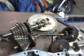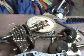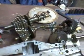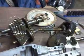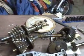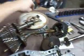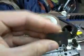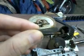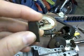also, if your brakes are pathetic and you've adjusted it as far as you possibly could on the caliper, well, the actuating arm on the brake rod, if you've adjusted that nut as far as it'll possibly go and your brakes are still pathetic, well, guess what? You need new brake pucks. That would be these suckers. These are brake pucks. You can see mine. Mine are fairly new. I put them in a few years back.